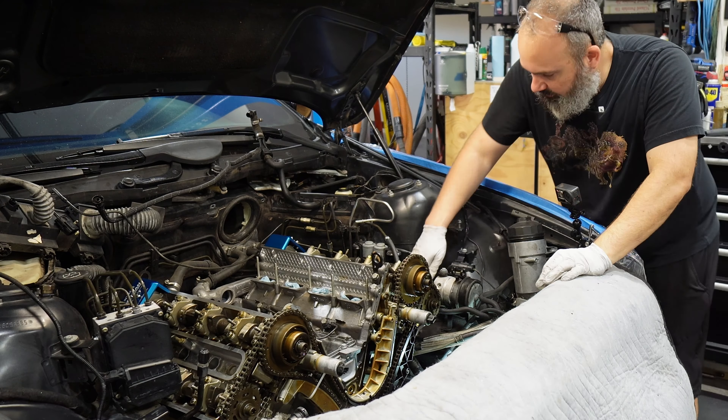Conventional thread — slide our gear off. Now we've got three 13s to drop the pump, and we're going to have some oil come out. There's one on the back hiding back here — lock-tight that one, it's a lock nut. This one on the passenger side with the bolt is our adjustment point. Wow, it's got a lot of Loctite on it — I thought it was pulling threads out. These both have O-rings: one O-ring will go here, one will go here, and one will go in the pump. Now we can buzz out our last two bolts.